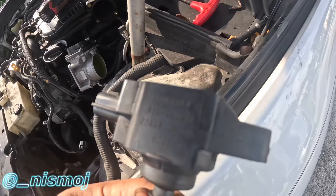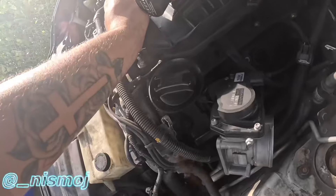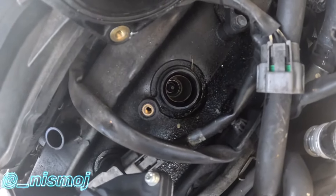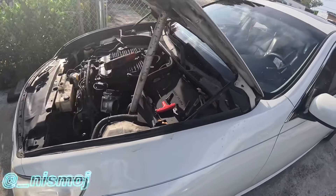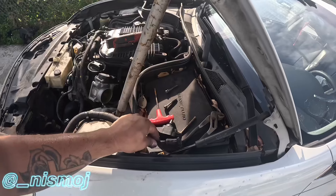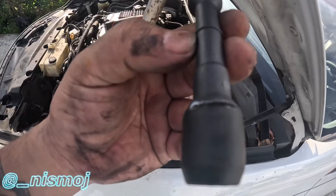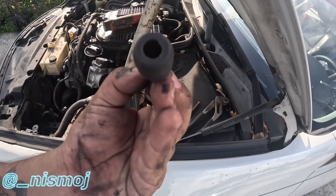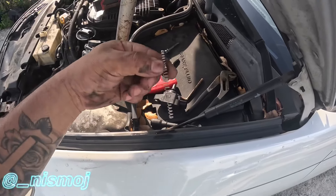These are not even OEM coil packs. If you're going to change your coil packs, please use OEM stuff. It's dry in there which is great news. I don't know if this was causing the misfire because it came apart when I pulled it off. It's a little bit burnt - look at those burnt marks, it even smells burnt. It just completely came apart - the spring came off.